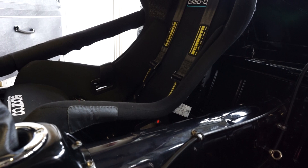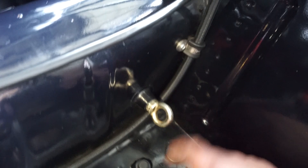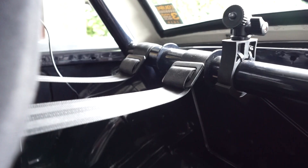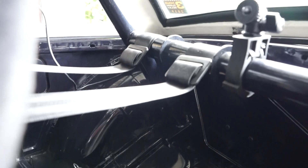For the seat belt harnesses you've got the proper links on the car already. For the other ones you've got a square pad welded into the floor from the underside - they will possibly be looking at those to make sure they've been installed correctly. Another thing scrutineers like is having your seat belt bar at the same height as where the belt would come through the seat. It's quite dangerous if you have a bar down low and the belt angles up steeply - in an accident there's a good chance of that pulling you down severely and hurting your neck.